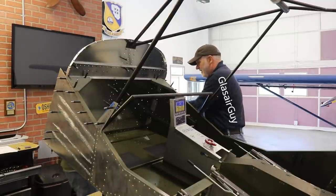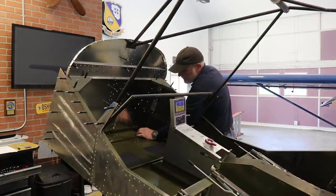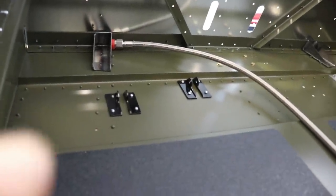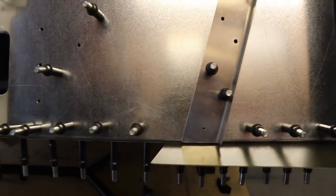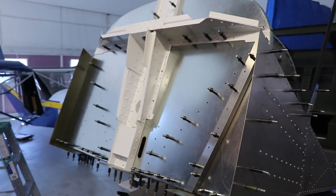Your guys' favorite YouTuber came over to give me a hand. Brian is going to hold these lower engine mount brackets in place, and what I'm doing on the bottom of the airplane is using a drill bit to go through the open holes just to mark on the mounts where the holes need to be drilled. We are really moving along with some nice progress. All of the engine mounts are done — drilled — and Brian came over and helped me drill these engine mounts. There's a little piece of aluminum that goes under those mounts, but they're drilled and ready. I did order my engine mount and cowling and it'll get here in May. Once I get the engine mount, I'll drill out the four mounting holes, and once everything is mounted, everything up here can get riveted.